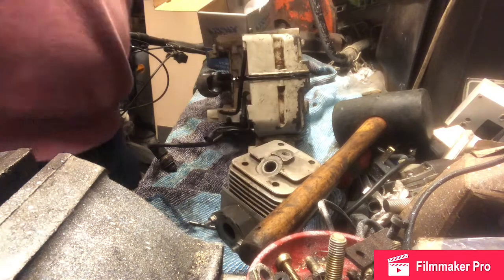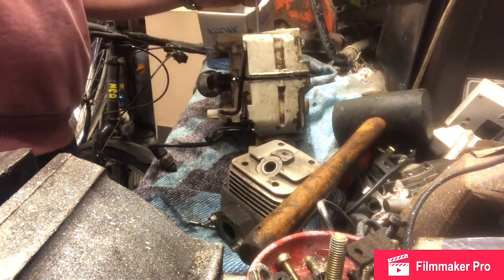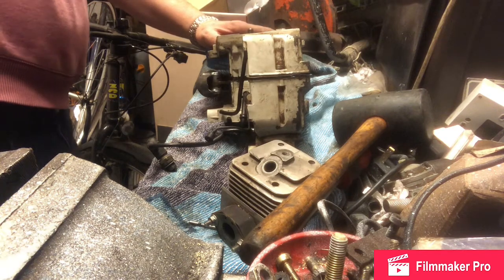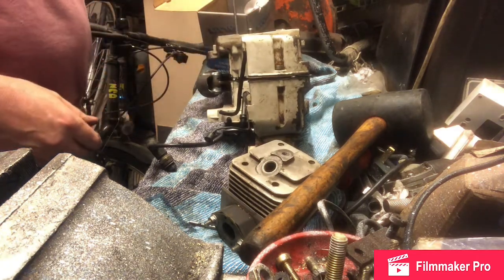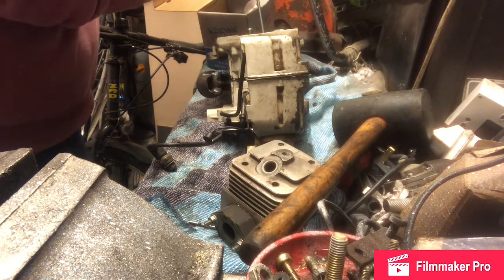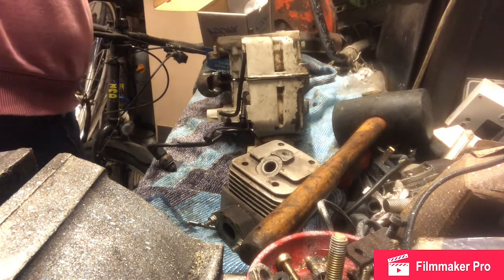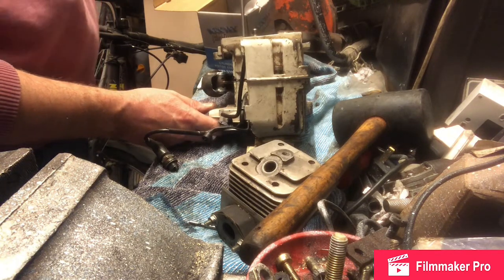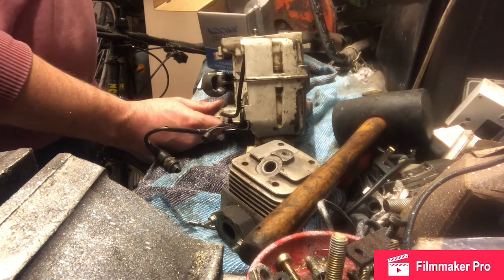That was not easy and we're not out of the woods yet. You can actually hear it go down as you turn the screws. I'm just going to gently tighten them up a little bit at a time, trying to keep it going down nice and evenly. Notice I'm focusing on the area where the crankshaft is — that's where the tension is. I'm not using too much force.